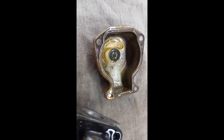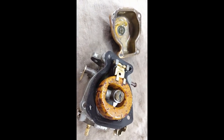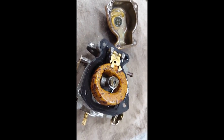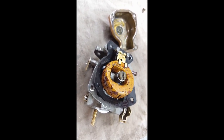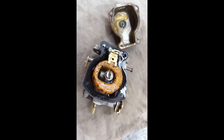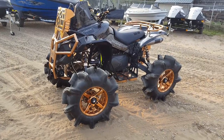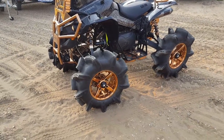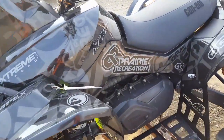I have a lot of stuff going on behind the scenes. This is a carburetor off a 9.9 Johnson — all gummed up with water and fuel that made a gel mixture and plugged all the jets off. I do a lot of this type of stuff. Took about an hour to clean this carb and get this little old 1982 Johnson running. Lots of stuff I don't upload to YouTube, and I should do more of it.